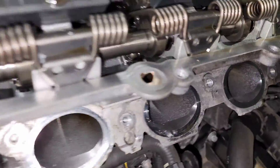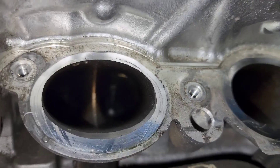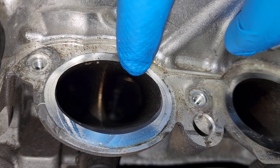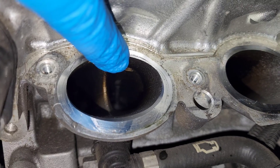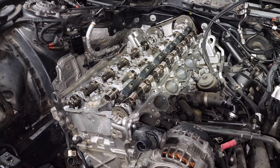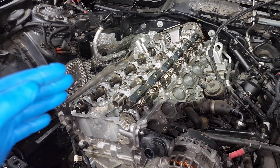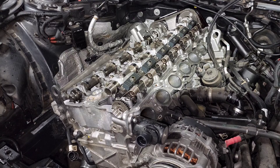What we're doing is plugging the ports on the cylinder head. These ports connect down through a channel into the cylinder head itself. The whole purpose is pulling a vacuum on the crankcase — one of the PCV vents pulls crankcase gases into that head port, and they travel through the cylinder and get burnt off.